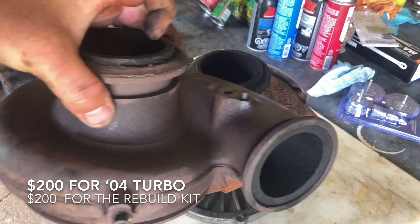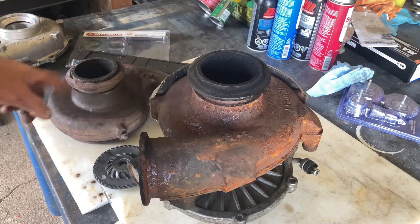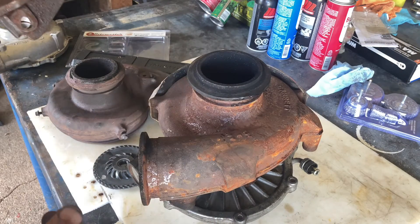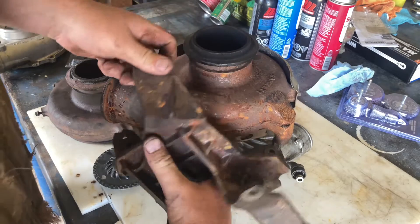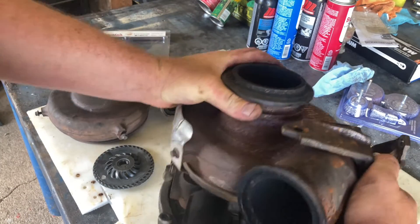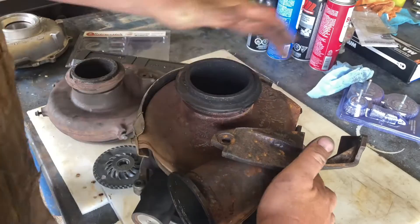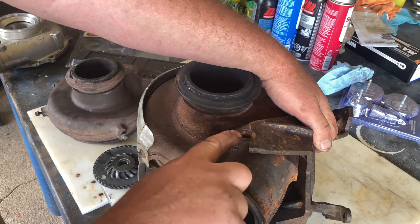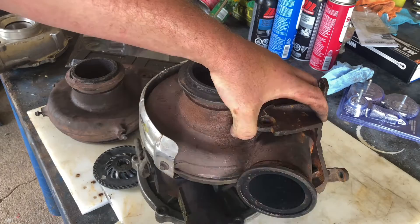I assume that this 2003 exhaust portion would fit on here, but the problem is it was beat up pretty bad from the impeller compressor letting go. So you can see here, if I mount this thing — exactly how it fits — on to the 2004, now that we've shaved it all down nicely. See, it goes right on. You can see there's just enough clearance to allow those uprights to actually support the turbo. The reason that gave me confidence was that on my 2003, this bolt was actually laying in the valley of the motor — it wasn't even in it. There's quite a bit of strength from the exhaust pipe on the back and the up pipe on the side. In a pinch, you definitely can do this.